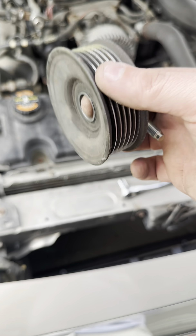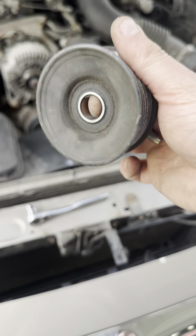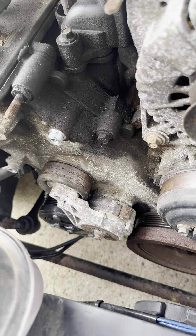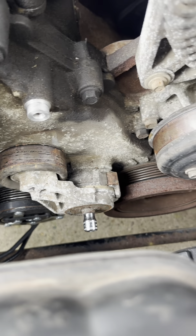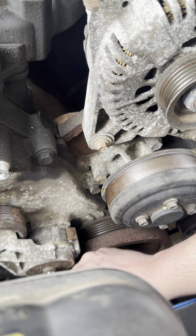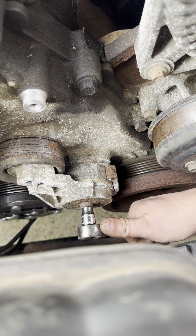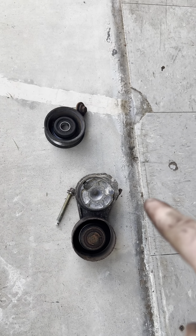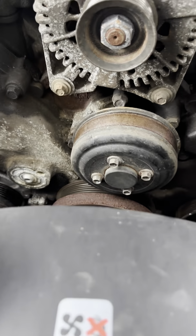It's got a little bit of roughness to it — not too bad, a little catch. But the one that's really making the noise is that guy right there. He's going to be a 10 millimeter bolt and we'll be able to break it free and get it loose. It'll torque back the same at 18 foot-pounds. Got them both off here.